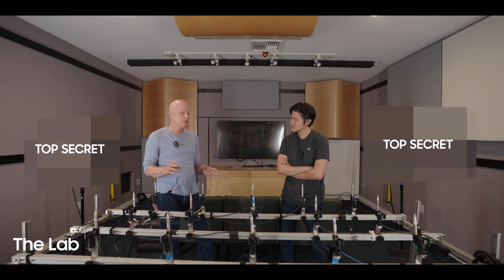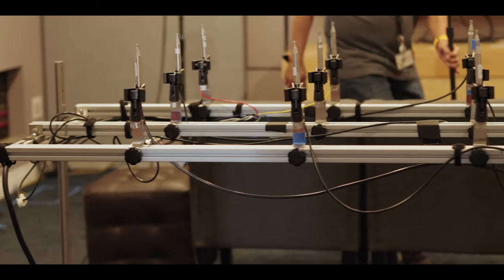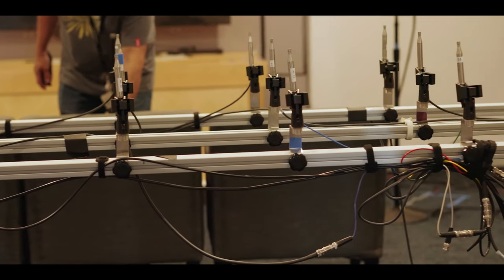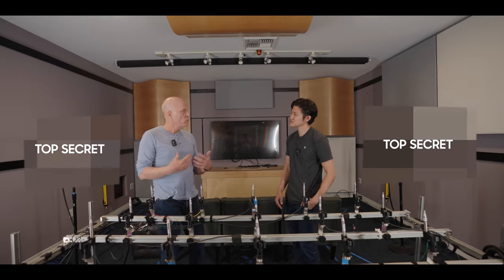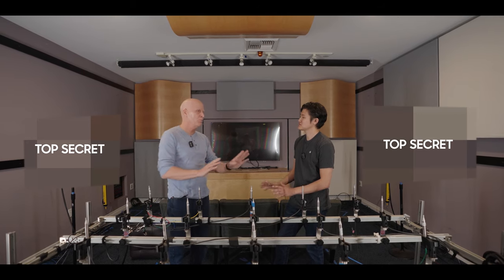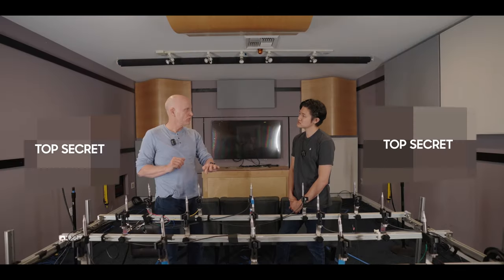We wanted to compare TV and sound bar sound quality easily, so we designed a wall section that can mount up to a 75-inch TV or a sound bar. You evaluate the sound, put your score on the tablet, hit A or B, the music stops, the door opens, the whole assembly moves in about four seconds, and the music starts playing again with a new product in the exact same location. Interestingly, people who know what they're doing never use a single microphone — peaks and dips from resonance versus reflection can look the same but sound dramatically different. Averaging across 15 measurement positions cancels out reflection artifacts, and the listener's position in the room matters less than the speaker itself.